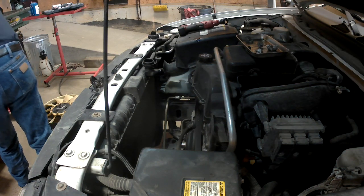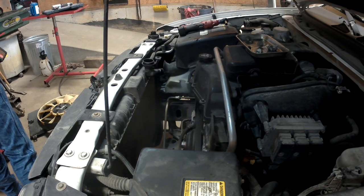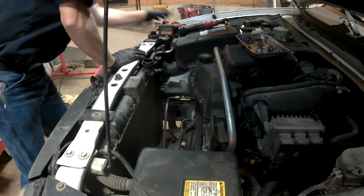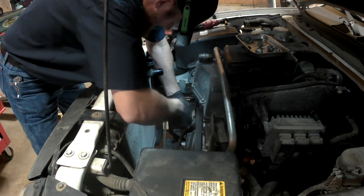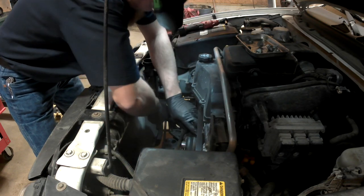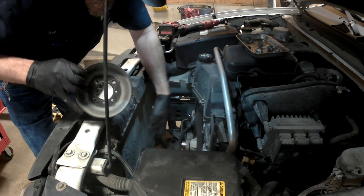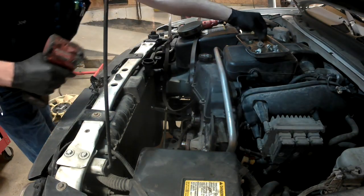There are also two transmission lines that mount to the back of the fan shroud on the passenger side — you'll have to release those from their clips. Once you get the fan shroud moved forward a little and push them out of their clips, it comes out pretty easily. Now, before you take the serpentine belt off, take the four bolts out of the water pump using an impact. Once you get those off, then remove the serpentine belt — it's just a 3/8 drive on the tensioner pulley. Pull the belt way up and out of the way, because once you take the water pump off coolant will go everywhere. If coolant gets on the belt, just wash it with water and dish soap — if you don't wash it off it may squeak for a while.